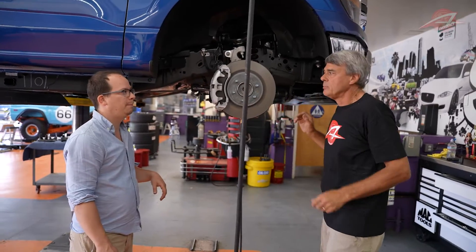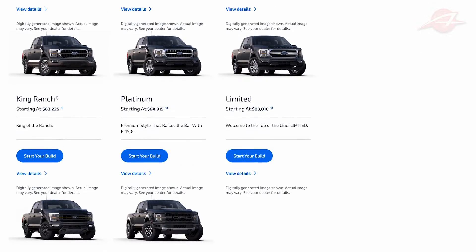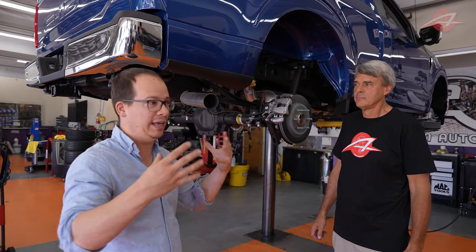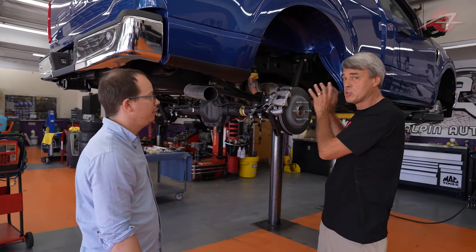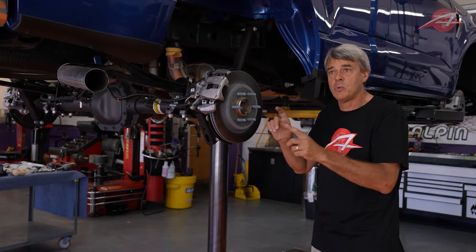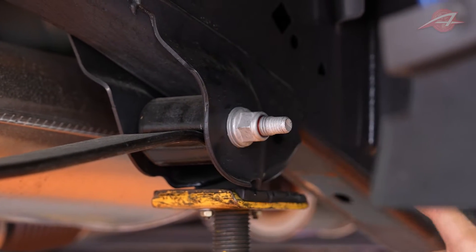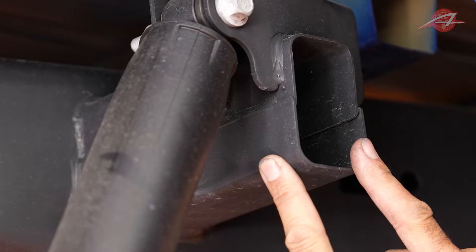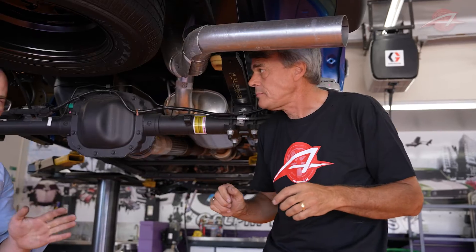If you're Ford and you've got this platform, in an ideal world you offer as many variants of the truck as you can with the exact same parts. But when you start to change architectural things like the frame, that's when things get expensive. And that's exactly what they did across their three models — three very different frame arrangements in the back to support the different suspensions. Looking at the frame that holds this Hotchkiss suspension: it needs a bracket up here to attach the leaf spring to the frame, a bracket in the back for the shackle, and different shock brackets. So get ready to go from bone simple to more advanced to even more advanced.